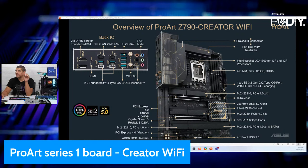For the M.2-based SSDs, you'll see that you have one M.2-based SSD, another M.2-based SSD, and then another two M.2-based SSDs, right? So 1, 2, 3, 4. Now, it is important to note that in terms of that specification support, these are all going to be PCI Express Gen 4. They're not PCI Express Gen 5. So there is not PCI Express Gen 5 support. If you did want to do PCI Express Gen 5 via M.2 SSD, though, you do have that secondary slot that you have available to you. So depending on how you wanted to set things up, that is an option for you to be able to have access to a PCI Express Gen 5 M.2 based SSD, right? But by default, the four slots that are on this motherboard are all going to be PCI Express Gen 4.